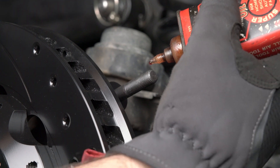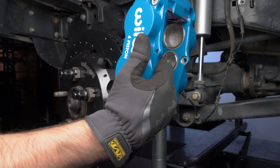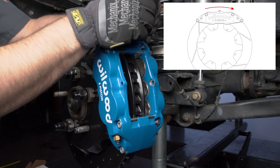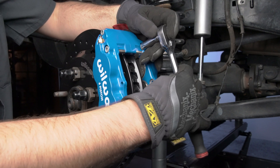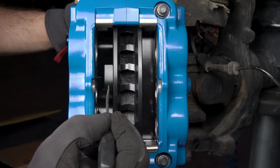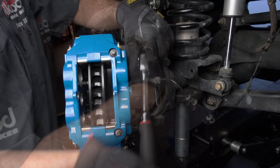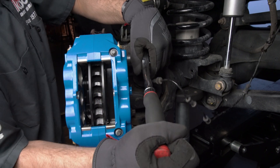Lubricate the caliper mounting studs with lightweight oil. Initially place two shims on each stud as shown. Note this kit contains distinct right and left hand calipers that must be mounted in a specific direction. Ensure that the caliper is mounted so the largest pistons are at the rotor exit end of the caliper in relation to the direction of rotor rotation. Mount the caliper onto the bracket using lock nuts and washers. Temporarily tighten the lock nuts and view the rotor through the top opening of the caliper — the rotor should be centered in the caliper. If not, adjust by adding or subtracting shims between the bracket and the upright, always using the same amount of shims on each of the two mounting bolts. Once the caliper alignment is correct, remove the bracket and mounting bolts one at a time, apply red Loctite 271 to the threads, and torque to the instruction specifications.